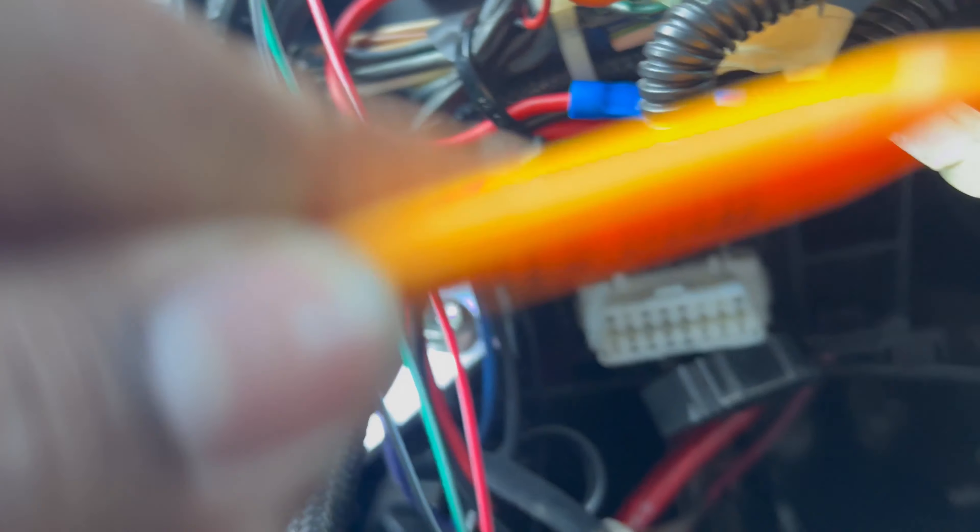Also as part of this kit, I wanted to make sure the remote start was working first before getting into this portion — which is the lock and unlock feature. When the remote start takes over the vehicle, it takes over your lock and unlock functions from your factory remote. If you don't wire this in, you'll have to use a key in your door. To maintain keyless entry you'll need to wire this up. The blue wire supplied is for the green-and-black wire coming out of the dash, and the green wire is for the purple wire coming out of the dash. The instructions show you in the pin diagram which wires to tap and which pin numbers they correspond to.